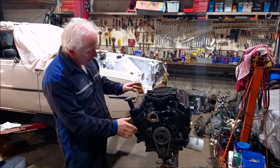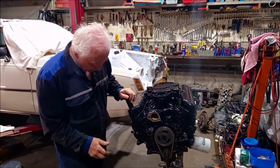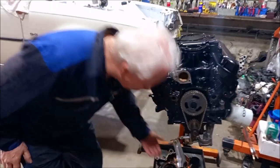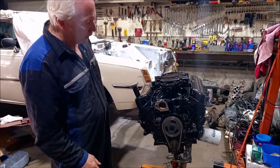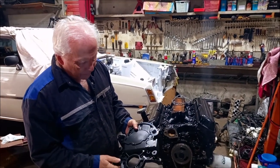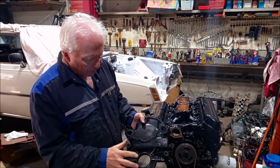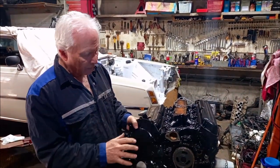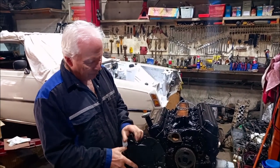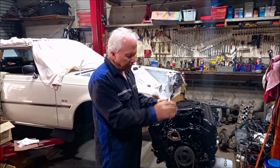We've got the motor ready now — all painted up. I've put a new timing set on it. Ford uses an inverted tooth timing set, but I prefer the true roller chain style. That's the same timing case from before, now coated black by Steve at East Coast Coatings. It's not powder coat — it's a chemical coating that is petrol and chemical resistant and doesn't come off aluminium. I've painted aluminium in the past but you have problems getting paint to stick, so this is the better solution.